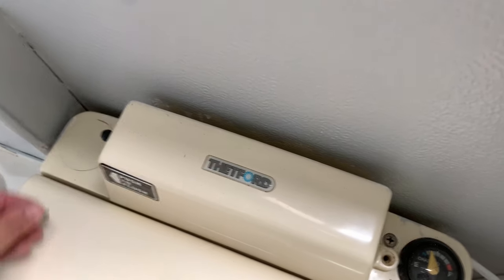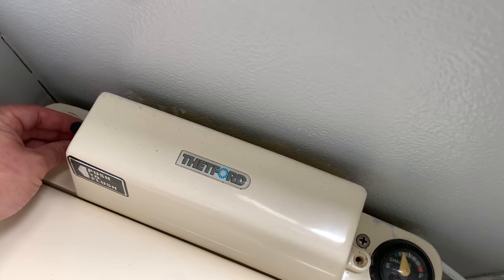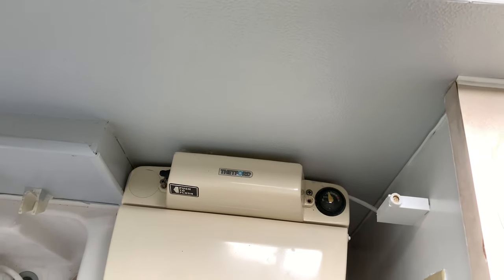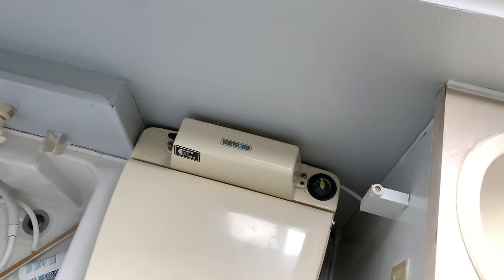So keeping with the seven amp, make sure you double-check that it works. Make sure the seven amp or five amp inline fuse is not burnt out either. I'm going to go ahead and screw the cover back on, but those are at least three tips to help you out in getting this recirculating toilet working.